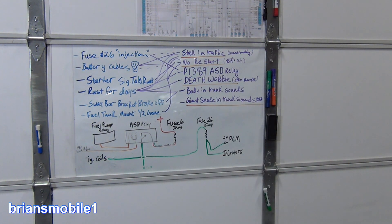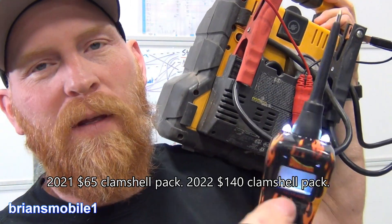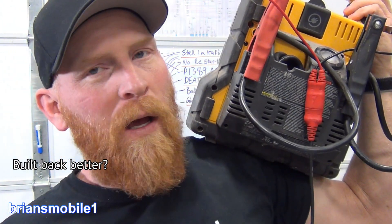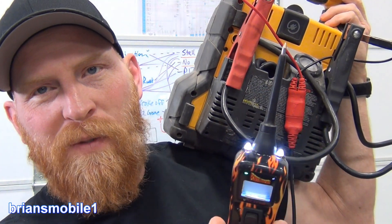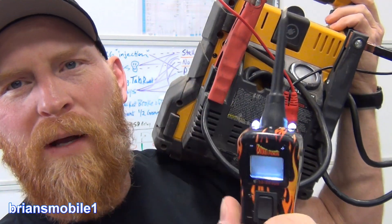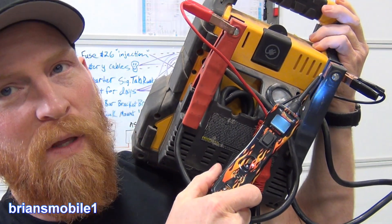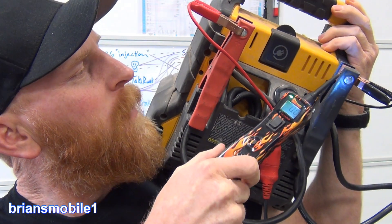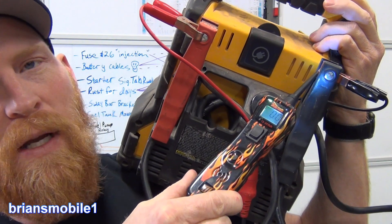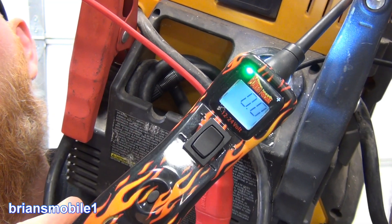What I'm going to get into is how you have tools at your disposal — stuff like this. These are a lot more expensive; they're like $140 instead of $65. But you can send power and ground depending on this switch. I'm sending ground, I'm sending power. And when you probe ground, notice I'm not touching the button anymore. You hear that Morse code thing? You're going to hear that later in this video. But if I have good contact, a solid good connection, it's just a straight tone and it's just a zero.